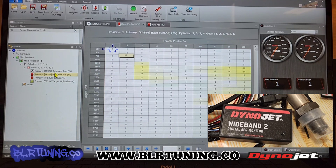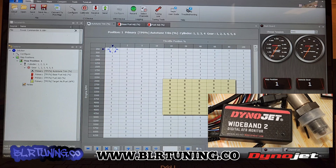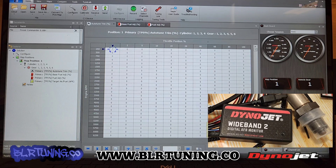What we're clicking on and looking for is auto-tune trims. We know auto-tune has now been added and is on. You can see I put the number seven here — this would probably never show up up here; you may have numbers way out here, way down here, or only at wide open throttle. It just depends on where there are actual AFR numbers. That is where you'll see fuel trims if any are needed.